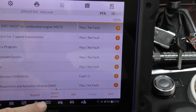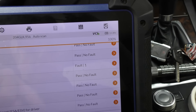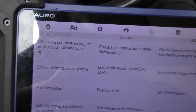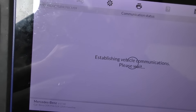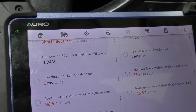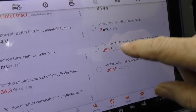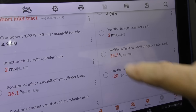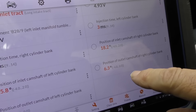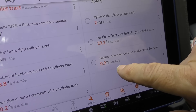It's only got two codes for the tire pressure monitoring system, which is no big deal, and a fault for the right front door — also no big deal. Now we'll look at some of the live data to see what kind of information comes out; we'll check out test failures driving the full load range. Right away I can see this data is bad — red means bad, you can see it's out of specs. When I rev it up you can feel the engine isn't running right, it got a little into the black here.